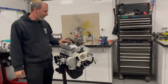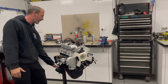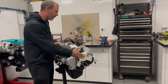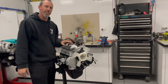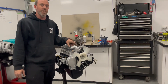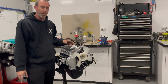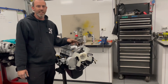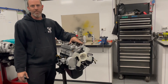Alright, so we're kicking some goals with this thing now. I've got a fair bit on today - all the engine mounts are on, the bracketry for the gearbox, alternator's all been painted up and that's on, water pump, pulley, fan belt, fan. I did put the thermostat housing on - now I did say in the last video I was actually going to flip that, and the reason for that was to suit the S13 Silvia radiator that's being mounted in the car. Looking into it a bit more, it's an alloy radiator so I'm thinking I'm just going to cut the outlets off, switch them over, and just get them re-welded on.